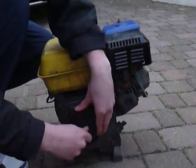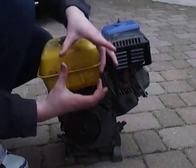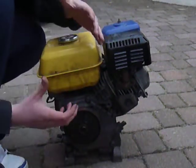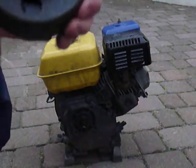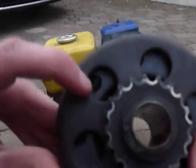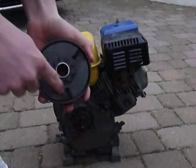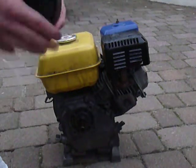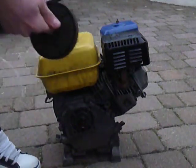But inside it, there's springs on, like, shoes, which when it goes over a certain RPM on the engine — I think it's about 4000 RPM — it engages. The springs inside of here, you might actually be able to see them. There are springs in here which then expand inside there, and that kind of grips onto the outside of this, which then makes that tin thing on the outside spin, which would then move the chain, which moves you.